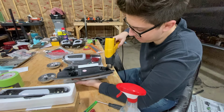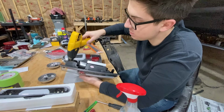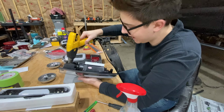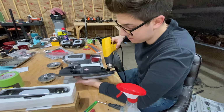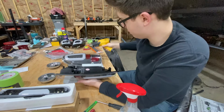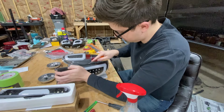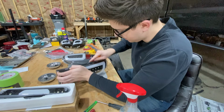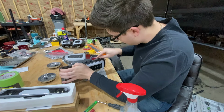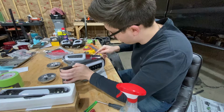And as we heat right through here, we wanna also keep back through here warm. Like I said, this is time consuming, but you don't have to worry about warping the lens doing it this way. And some people would even just cut them open, and you can cut them open. Some taillights you actually can only cut open. The way they're designed, whenever it goes together, there's no getting them back apart. For example, on the 08 F-150s, I'm yet to come across a set of those that I've ever been able to open up without cutting.